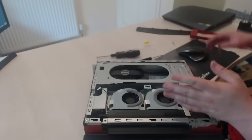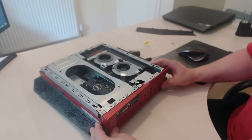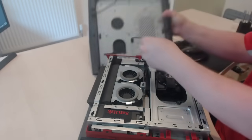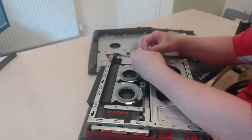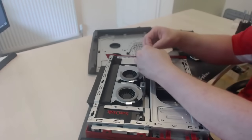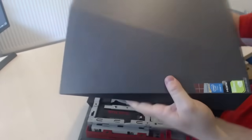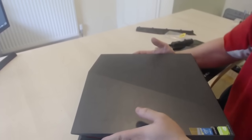Okay, so we've got the two screws in. Grab the back panel and put it back onto the computer. Don't forget to put the three screws in. Grab your top case again and hook up the plugs — they will be marked as number one and number one will be on there. Be very gentle with these, they break very easily. Be careful if you enjoy your case lights. Line the case up and make sure the wires don't get caught within the fan itself. Put the case back on — you want to slide it to the right as much as possible.